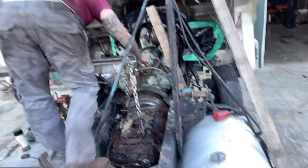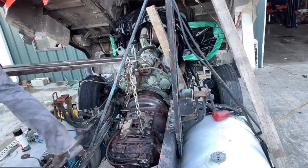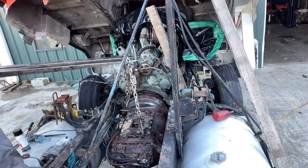All right, so get back on the forklift. And all you're going to do is crank it up and just drive it forward. You only got a couple inches, so put it in neutral. Okay, so neutral. How do you put it in neutral? That one over there on your left hand. That's forward, here. Yep. Right there. Hold the brake. Yeah, I'm on the brake.